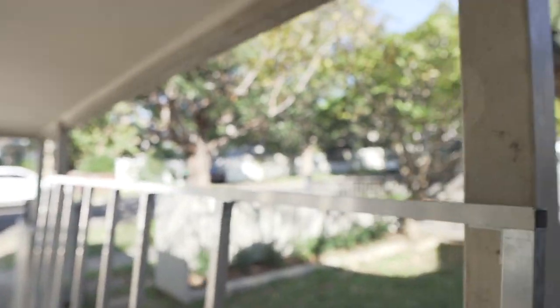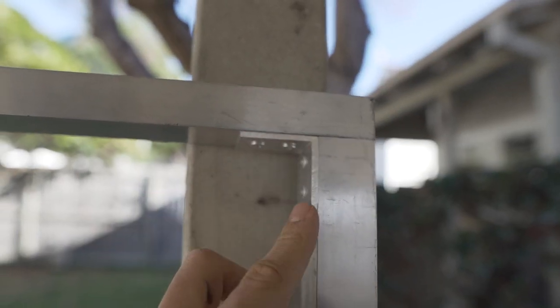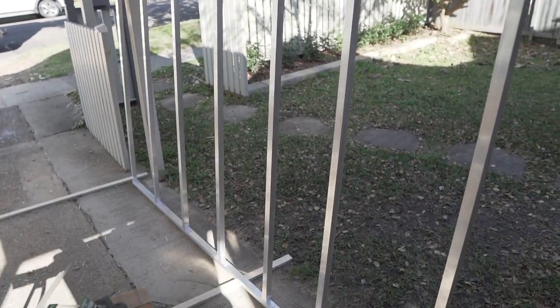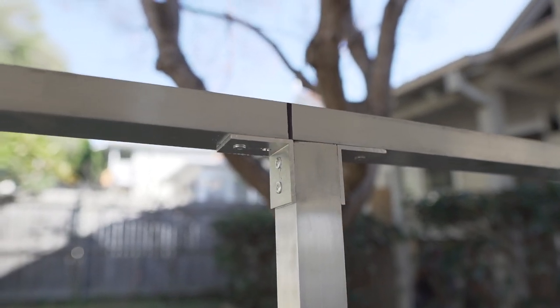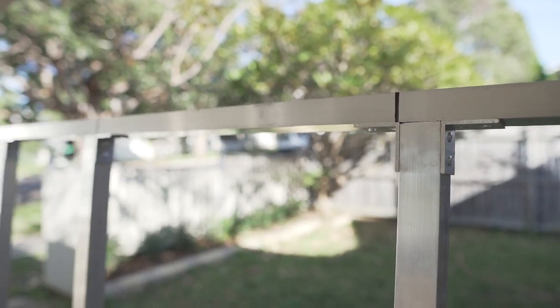It's another day and I've finished the aluminium framing for the roof rack. It's all pop riveted together. I've cut these angles on the table saw — 40mm by 40mm by 3mm. It is really strong; I don't think I'm gonna need to weld this at all. I might later on, but it's super strong as is. The middle sections have little angles on both sides. I only put one pop rivet in this side for now because I ran out, but I'll put another one in.